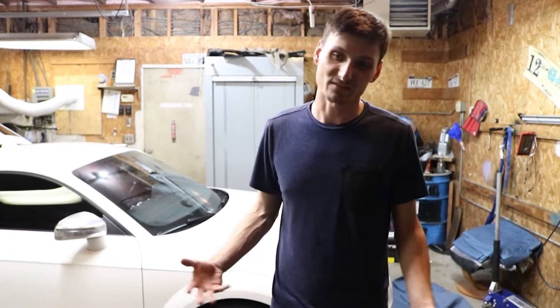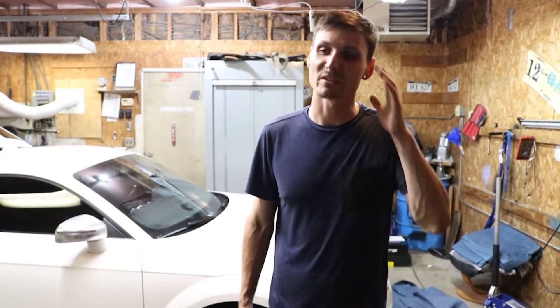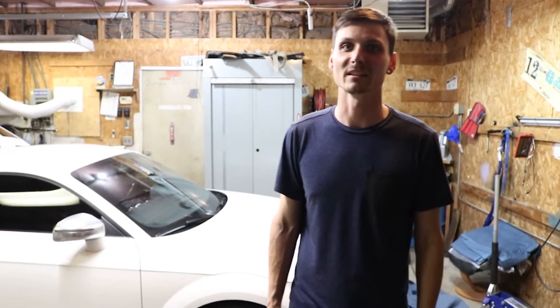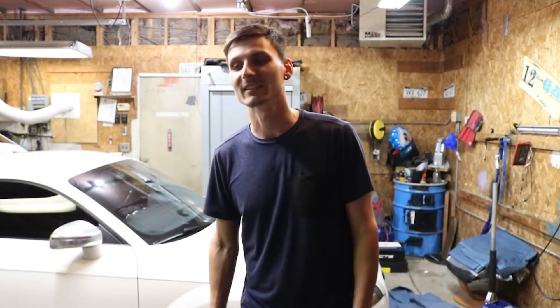I feel like the install went really smooth, minus the time — it just took a lot of time planning everything out. The wiring has quite a bit involved, a lot of wires going back to front and front to back. Maybe it's easier if your battery's under the hood, but mine's in the trunk where I already have a lot of power, so that's kind of where I decided to keep everything. As you saw in the B-roll, everything's mounted on the side of the trunk there, which works out really nice. Stay tuned for the next video — we'll give the car a whole Stage 3 review with methanol and see how the car runs and likes this new upgrade. We have pretty poor quality gas around here, so this should really help bump the octane up and add some protection.